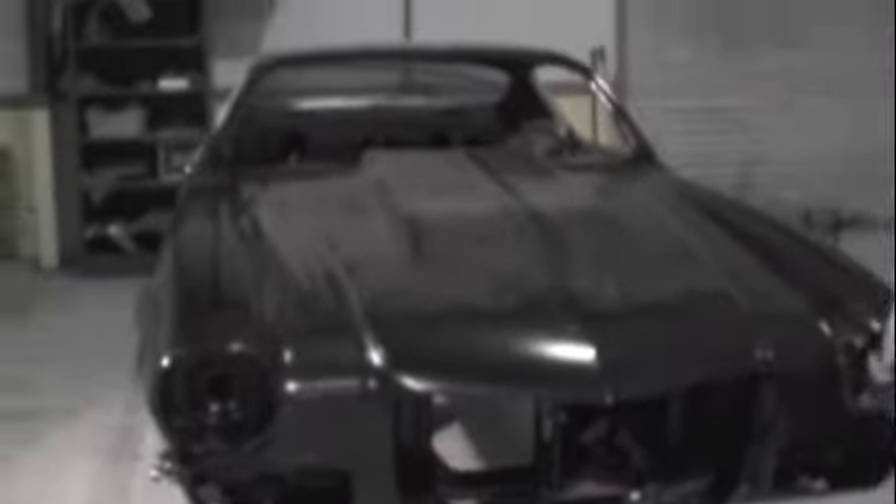You can see how it's raised up — we're ending up with a problem right here in the hood and some of the gaps to line up with the hood. We don't have hinges on the hood at the moment, we're just trying to gauge it, see if it matches to a degree. The hood's had some damage — there's a pretty good dent in it here and a dent back here. It was either dropped on the side or damaged. Besides that, we got some bows to the fender right here on both sides — identical spot on both sides. It's raising up here in the front corner and raising up there in that front corner.